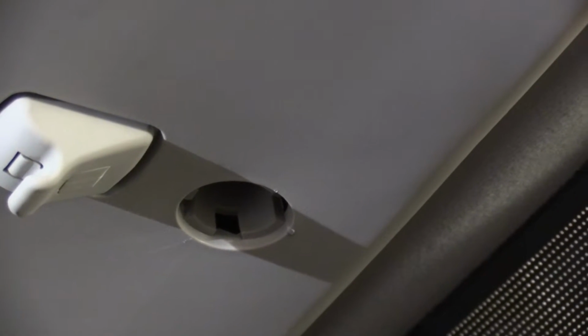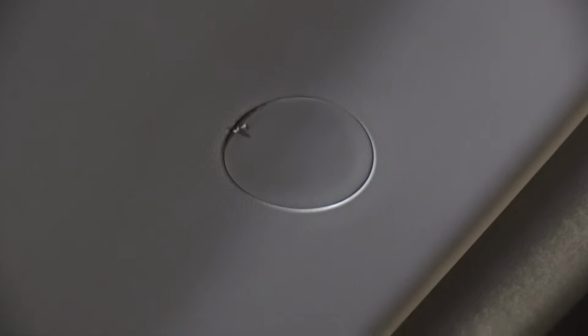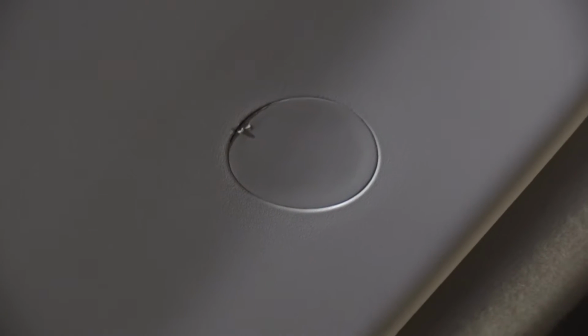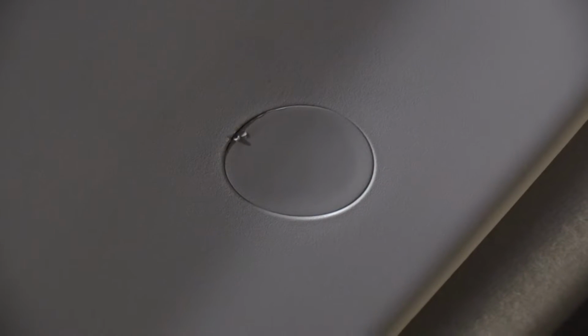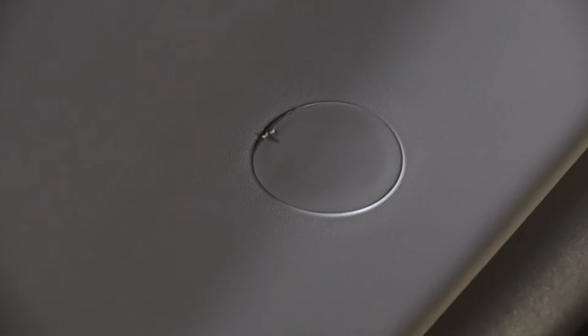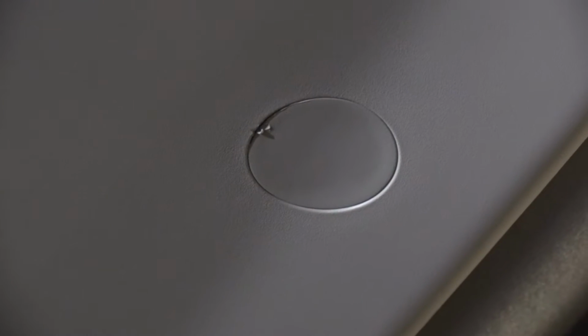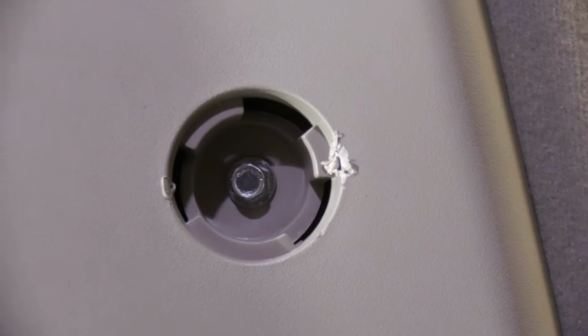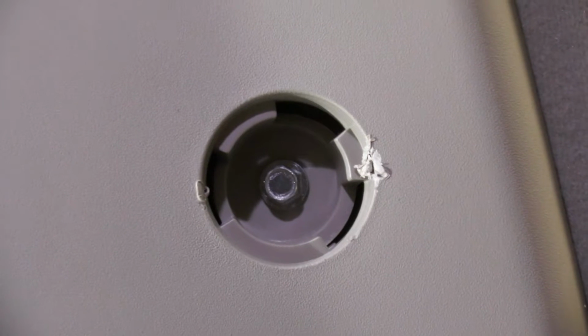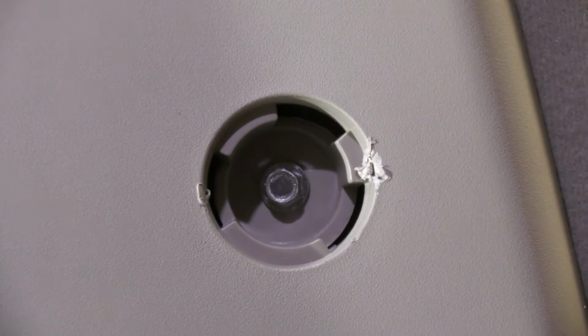Those are a little bit tricky to remove without damage. I went on the part towards the windshield with a knife blade. Just push it vertical in a couple times until you get it in, and just pry out that thing. It comes out, it's just pushed in. And here too you'll find 4 7mm screws that you can easily undo.